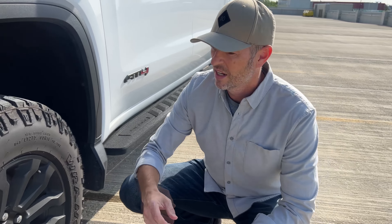To complement the airbags, I installed an onboard compressor. The benefit is keeping the bags full, filling them up, deflating them, and filling up again on the fly without the need of an external compressor. I also have the ability to connect an airline, but to do any real work like filling tires, you'd want an auxiliary tank. Because I might be taking the airbags out, I may just leave the compressor and add an auxiliary tank to have an onboard air system that can do a lot of work.